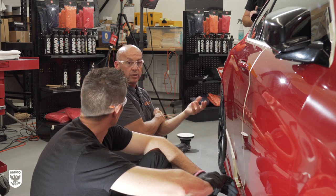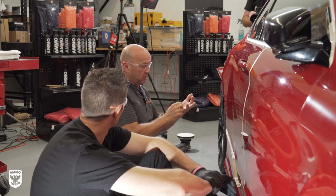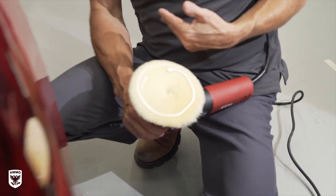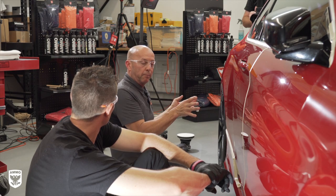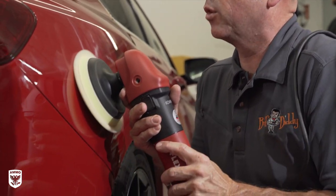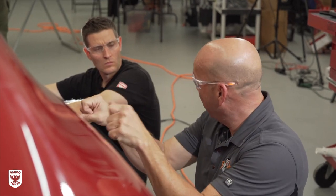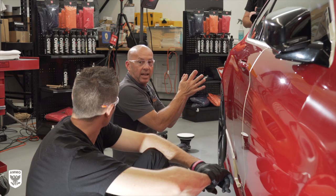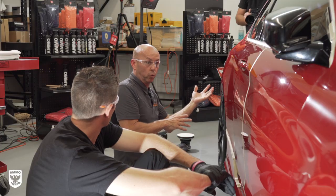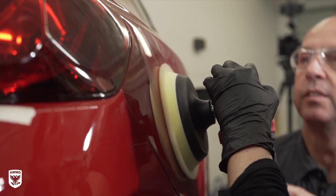As an example, if you're using a rotary polisher and you have long wool strings and you water spritz, every time you water spritz — depending on whether the wool is cotton, nylon, polyester, or actual wool — they have different absorbency rates. If you get a string pad that has a lot of absorbency, when it gets wet and you're spinning at high speed, the fibers start to get wet, they stretch, and they pack tighter and tighter and more compacted. What was once a soft, fluffy, contourable pad becomes condensed and dense and tight. That thing will just level. It can hop if it's loaded up, but it can also really level and cut rapidly. The drawback is it's going to leave a lot of string marks possibly, and chatter, hop, and bounce. There's always a plus and a minus.